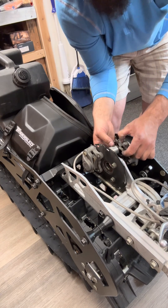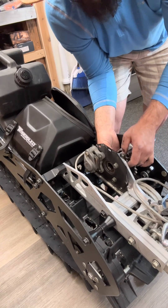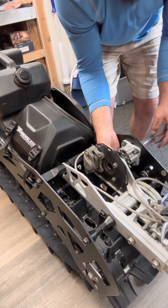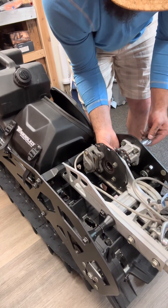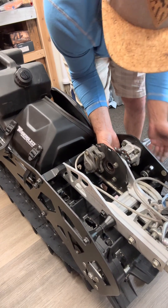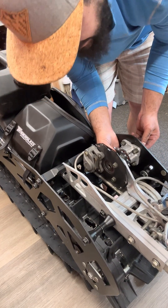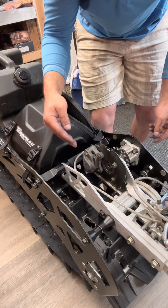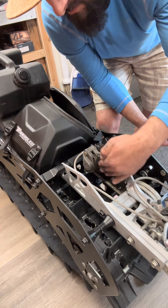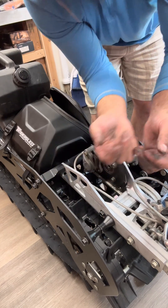This takes a little bit of finagling — you're going to have to get it in there kind of where you want it, and then just work the jack shaft until it pops through. You want to leave room right here so that when we go to add the brake rotor back in, you've got room to slip the disc in there. Now is a good time to wash your hands since you've got grease all over them.